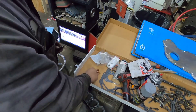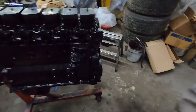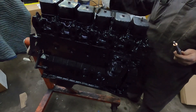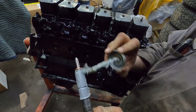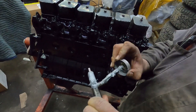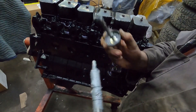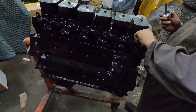This is the injector, meaning this isn't a crazy performance engine by any stretch, so we will be using the medium-sized washers. Now the holes are already clean, but you want to make sure those holes are clean because if they're not spotless, your injector will leak. What I do is cover the injector in anti-seize, and the reason I do that is they don't get stuck in there - I find that they don't rust in there that way. I put a little tiny bit across the bottom as well. I try not to get too much on the nozzle. So the washer is on there.